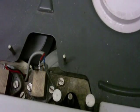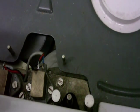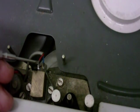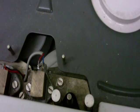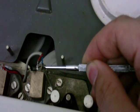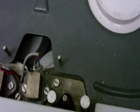You need to find out which connections on the head are the signal and the ground connections. You'll notice on this cable there are two wires — one red and one blue. The red one is usually the signal wire, but the wires can be all kinds of colours. To test which one is the actual signal wire, just touch one of the wires on the head — if you hear a buzz, you've found the signal wire. If you touch the ground wire you may hear a little click, but if you don't hear a buzz, then you've found the ground wire.